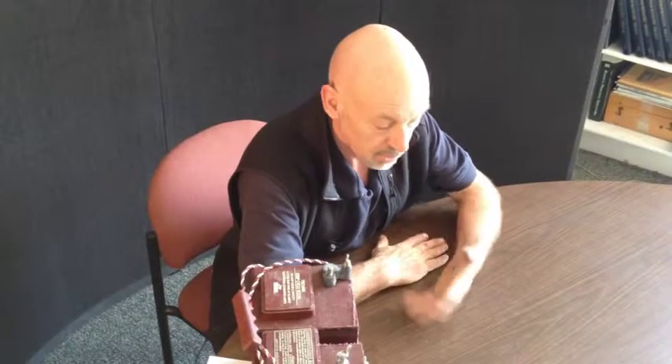On a large cruising boat, we could have a dedicated starting battery that would have more plates, and its best use is just to start the engine or for emergencies, and a specific house bank — as long as they're kept isolated.